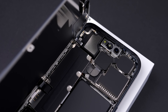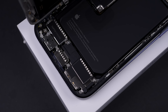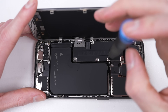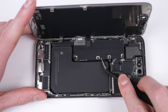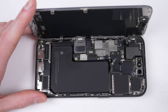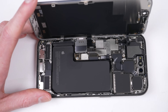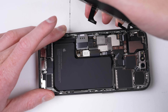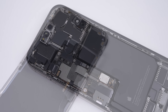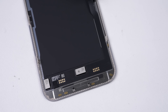We now have our first look inside the iPhone 15 Pro. While set out similar to last year's, it's actually less embellished, with the CPU branding no longer printed on the main bracket. Removing the main bracket, we can begin to see the logic board. Visible are several cables with data matrix codes etched into their connectors — from experience, these are usually the software-paired parts. The battery connector has also been labelled, something new to this model. We can also see the display itself, which now has a clear plastic border opposed to a black one on previous generations.